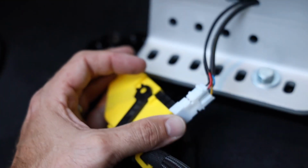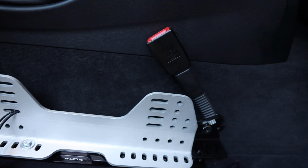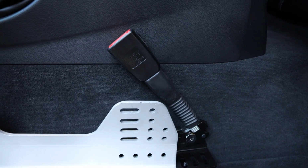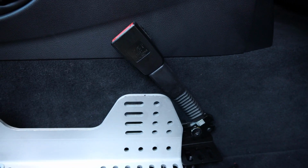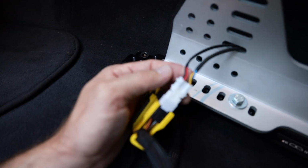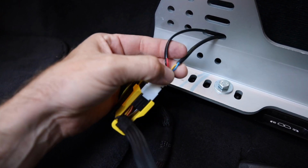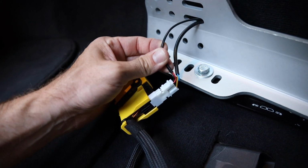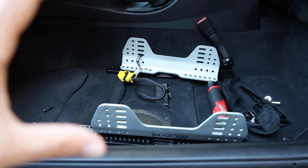So on the restraint system right here, it has a discharge, or basically a retractor. Is that the name of it? Anyways, a shotgun blast basically shoots out right here. This thing shrinks up and it tightens your seatbelt down. That's the idea. So one of these wires is a seatbelt indicator, basically saying, hey, your seatbelt's plugged in. And the other one is for shooting the shotgun blast. Skinny wire. So the red and black, it looks like, is the seatbelt indicator, like is your belt buckled. And then the blue and yellow seem to be for that retractor thingy. That's how that's going on right now.